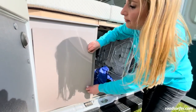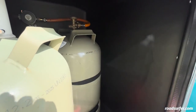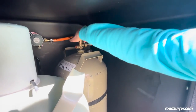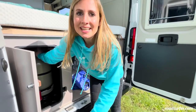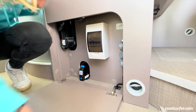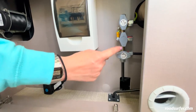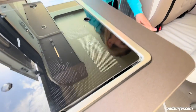You have another small storage room here. If you open it up, you will see two gas bottles. This is the spare cylinder — we don't need that one for now. But we need the back one for cooking and for the auxiliary heating. If you want to do either cooking or heating, you have to turn on the gas bottle by turning the wheel on top. It is very important that you turn it back off again after cooking or after you have used the auxiliary heating, so that gas does not accidentally flow into the bus. In order to cook, open the gas bottle at the back and then behind this hatch you will find another gas tap with a cooking pot symbol on it — turn the switch so the gas flows to the cooker. Then you can turn on the cooker using these buttons. After cooking, close the gas tap again — this one and the bottle too.